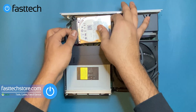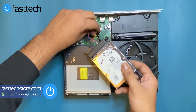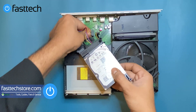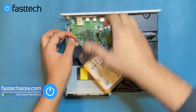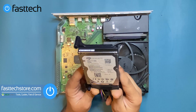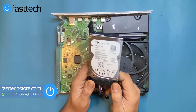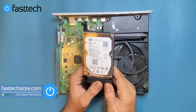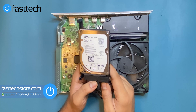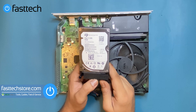Next, we're going to remove the hard drive — we're going to lift it out. There are two cables underneath: the power cable and the SATA cable, and we're going to pull them both out. If you're getting E105, E106, or E101 errors, or if your Xbox One stays stuck on the green Xbox loading screen, it's a hard drive related issue. We did a video on this a couple of years ago on our channel — you can go check it out.